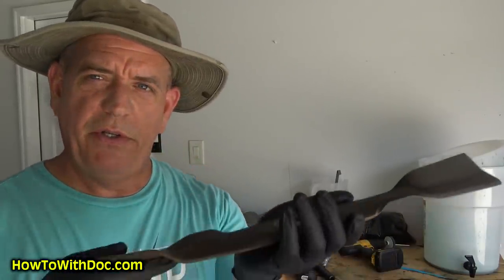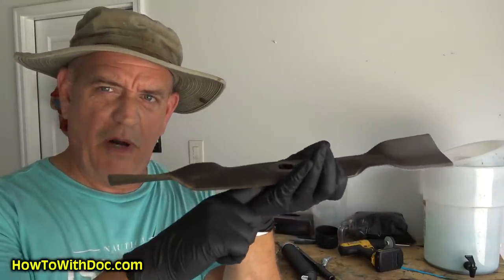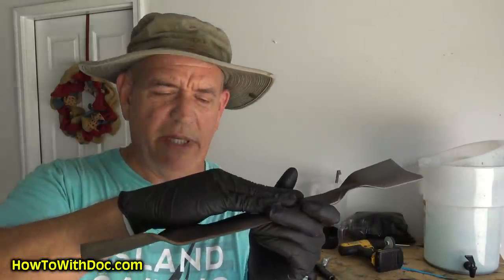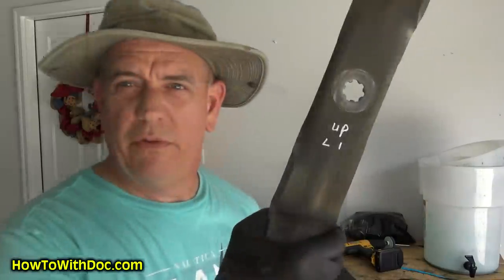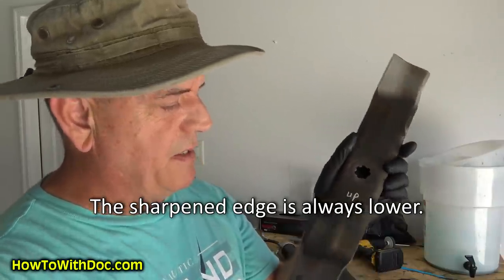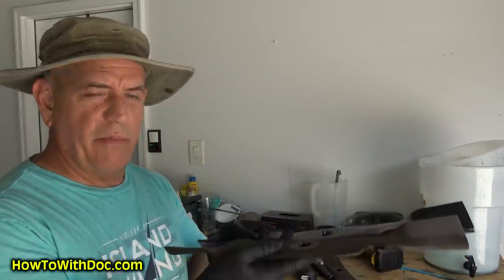I also make a note that the washer goes up. When you take off your blades, you'll have a nut, washer, and blade fall into your hand. Almost all mowers have a washer on top, then the blade, then a washer underneath, then a nut. The washers are often this convex shape - they're sort of rounded and they squeeze down to put tension on the blade, spreading it all around rather than just on the threaded piece. You need to remember which side is up. As soon as I take a blade off, I put it on the ground and write the orientation on it so I know when I reinstall it.